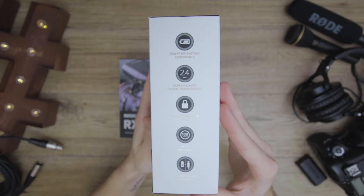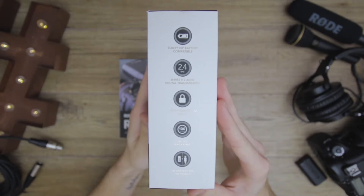The wireless system uses a Series 2 2.4GHz digital system, which is a lot more stable than conventional UHF systems. If you're a filmmaker who travels, digital systems won't need any licensing — some UHF frequencies are now being sold to companies and require licensing abroad. Go with the digital system; forget about UHF. Digital systems are close to Wi-Fi frequency ranges, but these systems are well-developed and constantly look for the best channels, so you won't have any audio dropouts. They continuously keep looking for clean frequencies and keep switching without any interference.